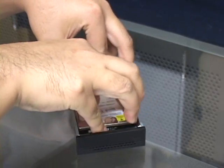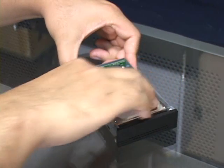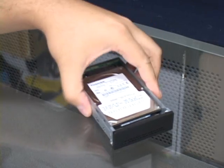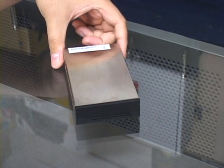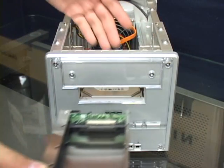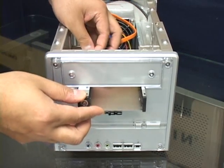Installing the Dataport 25 is simple. You install two drives into the carrier by snapping them into place and locking them down with the included screws. The drives don't have to be of the same make, model, speed, or capacity, but generally it's a good idea to make them as close to spec as possible, since all but one RAID mode will limit your total storage according to the smallest drive. With the drives mounted, slide the tray into the enclosure and fasten the screws on the back. The enclosure is now ready to slide into the tray. The Dataport 25 docking tray slides into your desktop or 3.5-inch enclosure much like any floppy or hard drive.